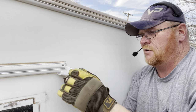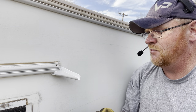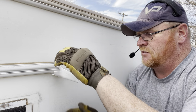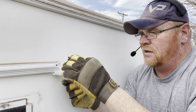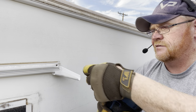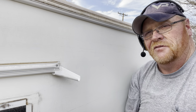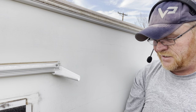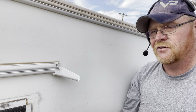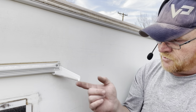Same thing — pull it out just a little bit, go right up underneath there. The main thing you don't want to have happen is your silicone to block it. You want your water to be able to run or to flow freely. There's a little bit I kind of got right there — take my screw there and smooth it down. And it's fine, 100% fine, it's all working good. Put it back into forward. Last screw — it actually went in a lot better than all the other ones. So that's all four rain gutters. I wish I had thought about this before I put the other ones on the corner of the camper, but I didn't. That's all of them — silicone in, screwed in. Again, all this is going to do is keep the water from running down the side of your camper. It'll cause any kind of erosion on your silicone on the sides — it pushes it out of the way a little bit.